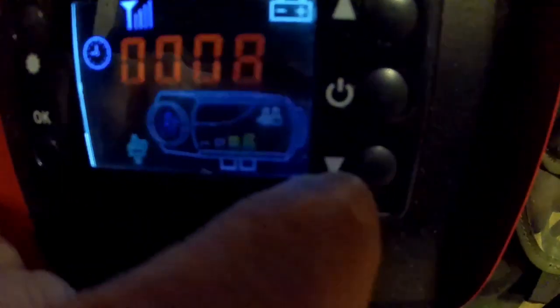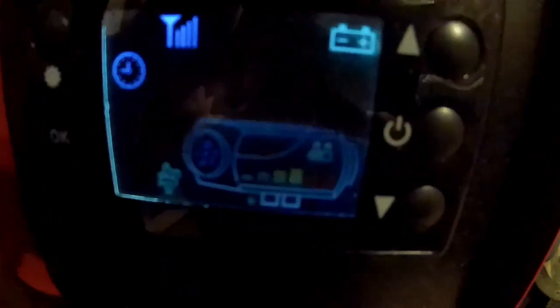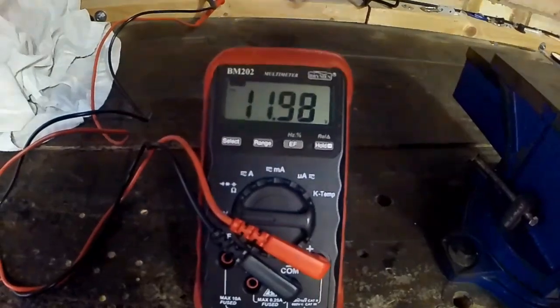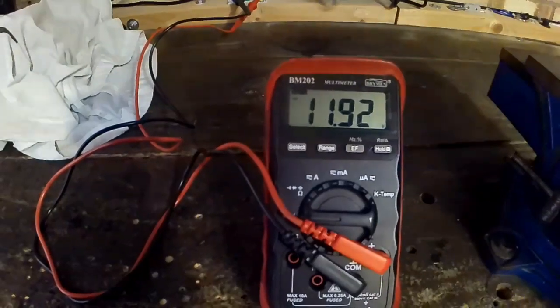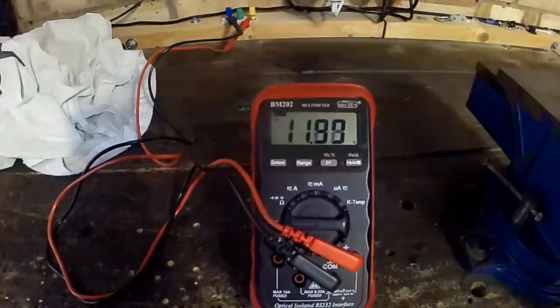See if I can get it on the camera. Hold on — one, two, three, four, five, six and it shuts off. It's going through the shutdown procedure. The glow plug heater is on and it's ticking — just ticking the pump. The voltage is now 12V and will probably go down even more, because the glow plug is on as part of the shutdown process. What it does is pump a little fuel into it and the idea is it burns any residue inside the burn chamber. You've got to let it go through the proper shutdown procedure.